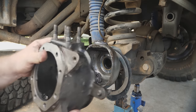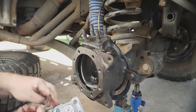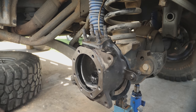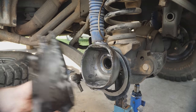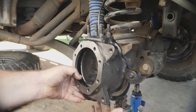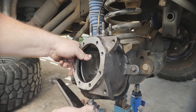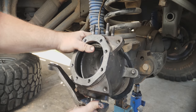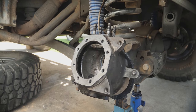Now because this is going to see a water crossing or seven, what I like to do with the bottom arm is put a coating of RTV blue on there, and put a very light coating of molly grease to sit the bearing in. So it's a bit of a juggling act — the race has to go there, pop that in, then line it up and go through the bearing in the bottom.